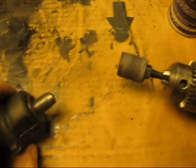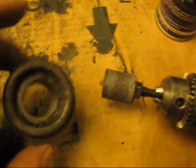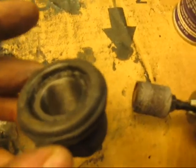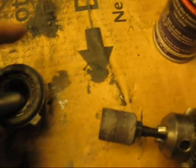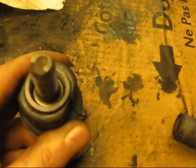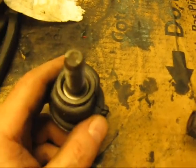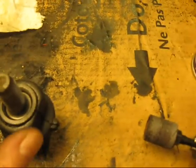And then the bushing here has a steel ring inside of it. We're going to burnish that a little bit. We're going to just ream it out, or as I like to say, hone it a bit to fit it. And so, with the camera in one hand, I have to try to do this. We want it to just sort of slip down on there, with a bit of force. It should be tight, because you can't have any real play, otherwise the whole thing will just slop around. So this was a little too tight.